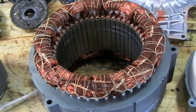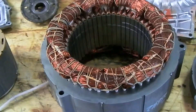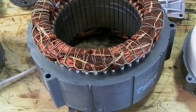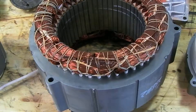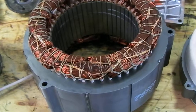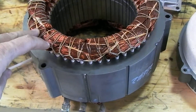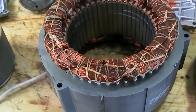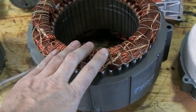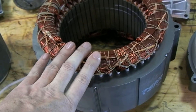The vehicle is going to rely a little more upon the gasoline engine. The gasoline engine on the Toyota hybrids assists the electric motor — it's not like some hybrids where the electric motor assists the gasoline engine. With the power split CVT on a Toyota, it's the other way around. So you're going to have sluggish performance, you'll have a check engine light, and then the main warning light — or the red triangle of death, as it's sometimes called — will also come on.